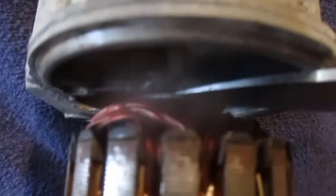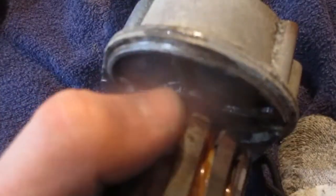So let's see, front bearing, try to get some oil down in there, I guess, without getting it on that one. There's a metal washer in there, you see, and a double spring washer behind it. You want to pry it back and then put the oil in there. I just kept taking my knife, prying that back, trying to get oil in there without really getting any on the armature. I figure a little bit at the front's okay, but you need to try to avoid it. I don't think I'll put any on the outside. I think I've gotten enough in there that it'll work.